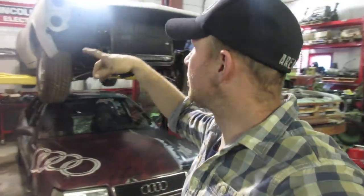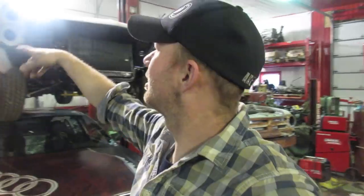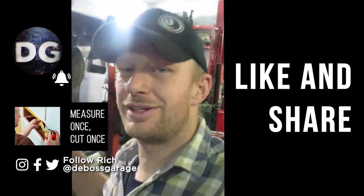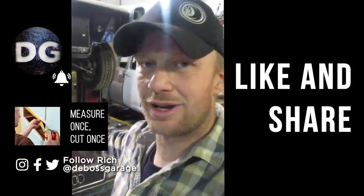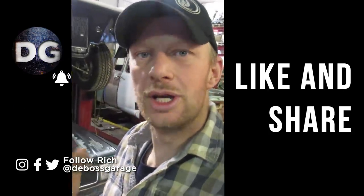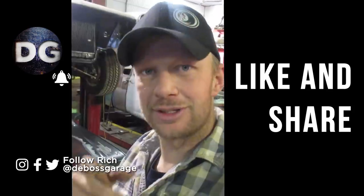The airlocks on mine are disconnected, so I still have to hook those up and flip the safeties over manually — I'll run to Princess Auto for that. The cables connected between the two posts on this hoist just level it. On my four-post, the cables run the whole frame and there's one cylinder that lifts — the entire car is on the cable. You can get certified replacement cables made properly — do not make your own cables. Remember, it's not that daunting of a job. Stay filthy and do it safely.